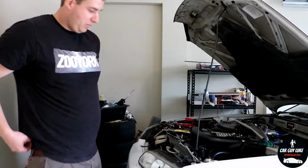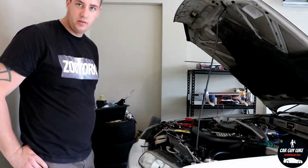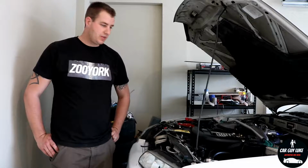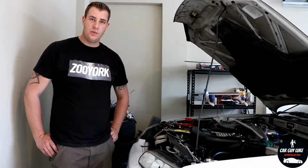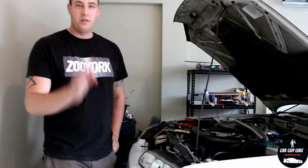So she ain't pretty, but taken enough off. So now everything's going to line up. What the issue was last time was the bumper was touching the intercooler. So you'd put bolts or zip ties into it and it would just constantly be under pressure, so as soon as you hit it, it would just fling off. But now I've taken care of that, and with these new brackets it should be pretty mint.